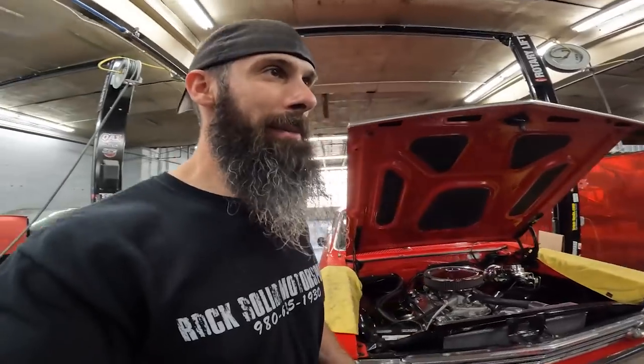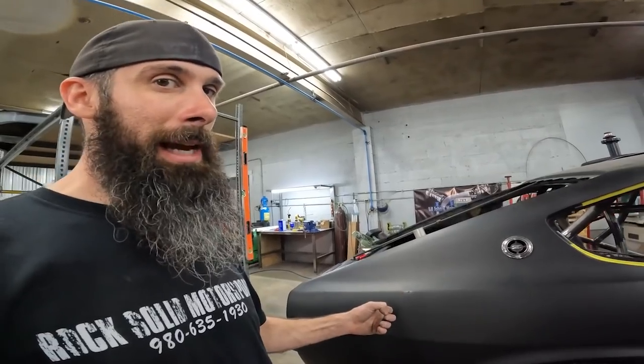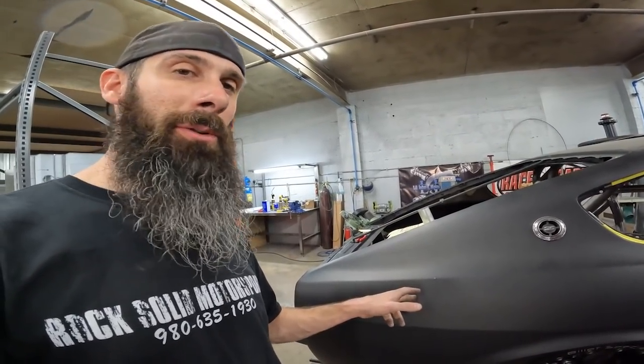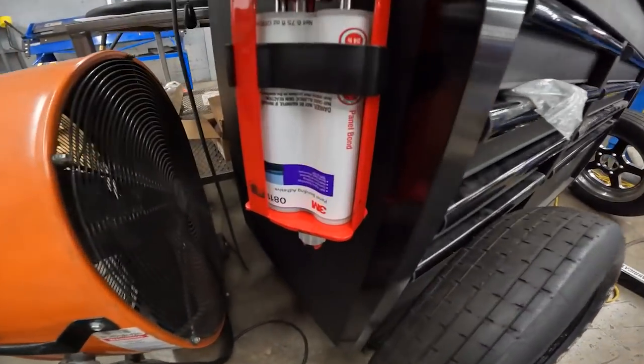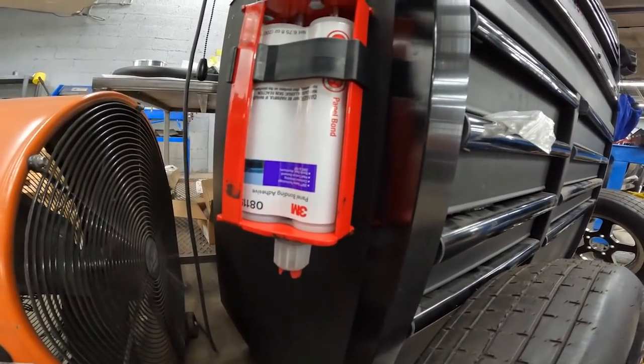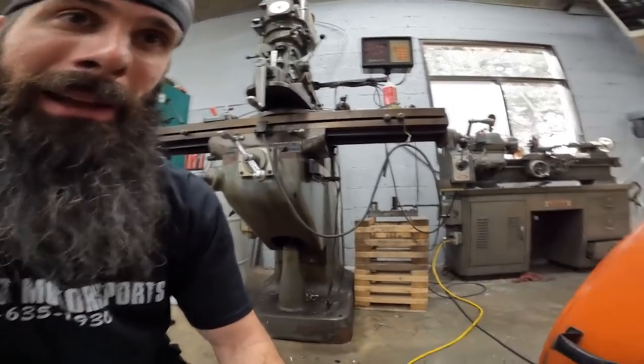I know the updates have been kind of scattered. One more thing - the panel bond. I did get that stuff put in. You can see underneath there - got the end glued in there. That stuff sticks and it's as hard as JB Weld. If you grab those rods and try to move them, it's moving the metal. The great thing about it is the applicator gun that comes with it - it's a two-part mix. You can put the little plug in there after you're done and then you don't have a dried-out canister like you do with seam sealer. You can keep using it until you run out. That cartridge is like $50.